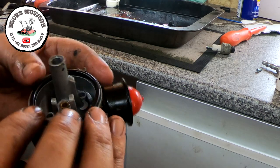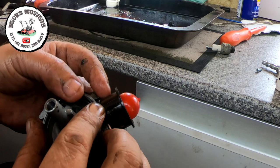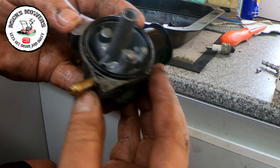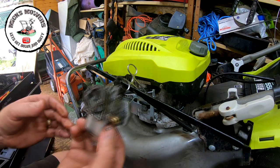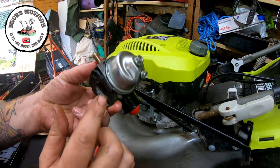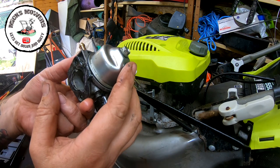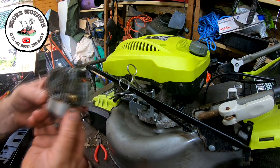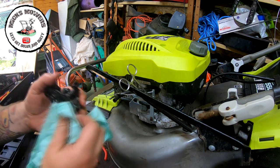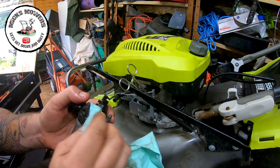We're going to have a go using one of these today and see what that does, see if it doesn't compress down to where I want it, and then we'll try that. Right, the carburetor is now fully back together. I've cleaned it out behind there as well - removed gasket glue and put the new O-ring on. Hopefully that's going to seal. It's a bit of an experiment, really. I've got a bit of a rag to try and take off a bit more of this carburetor gunk where I can.